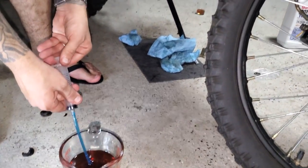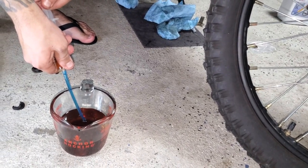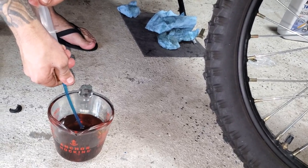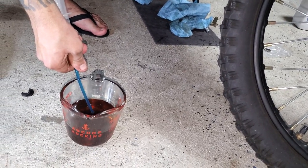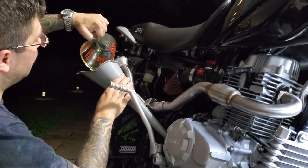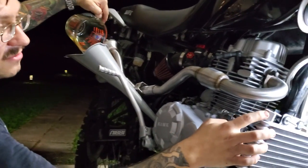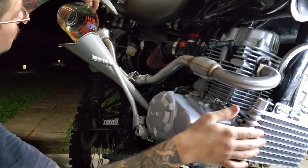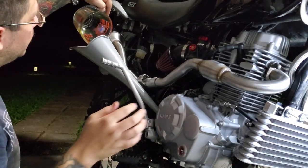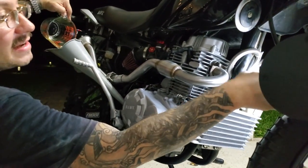I think the amount that goes into the cooler is about 125 milliliters — I'm just going to fill it until it looks full or until I can see it in the reservoir. Now I'm putting in my recommended amount of Rotella, which is 1.2 quarts — some people say just one quart. I'm putting in a little bit extra because I never saw this overflow. Then we're going to start it up and see how it goes, but first we've got to mount this last line.